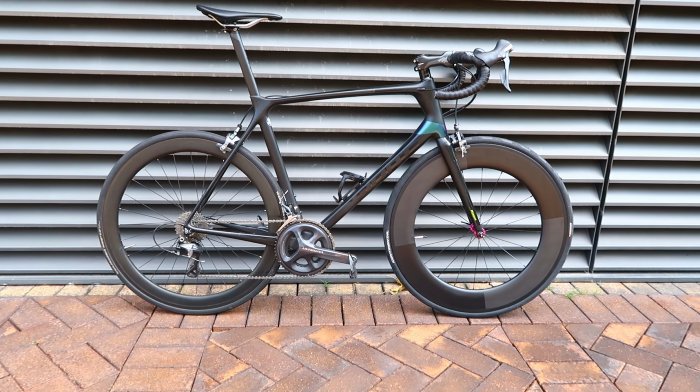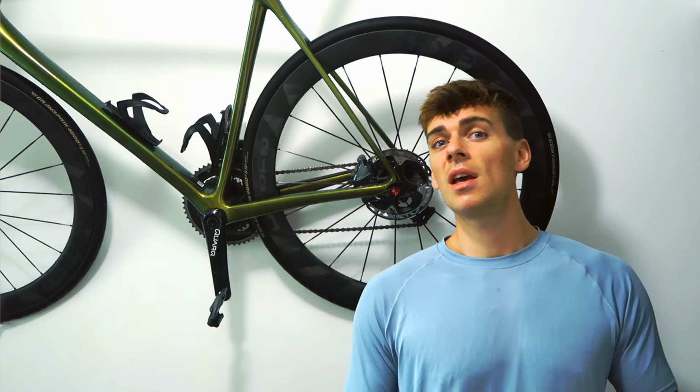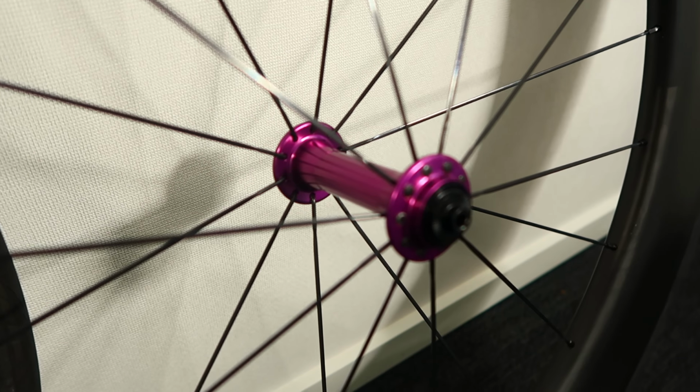because it's the front wheel that sees the most clean air, the free stream velocity. The rear wheel doesn't really get you many benefits if you go super deep on the rear for a road bike, especially if you're trying to save weight, because by the time the air's got to the rear wheel, it's disturbed quite a lot. It's got the vortex streaks from your thighs and your calves. It's probably not stayed attached around most of the frame, and you're asking quite a lot of it if you think it's going to stay attached by the time it's got to the rear wheel. Whereas the front wheel is really the thing that air hits first, and it sets everything up for what's downstream.